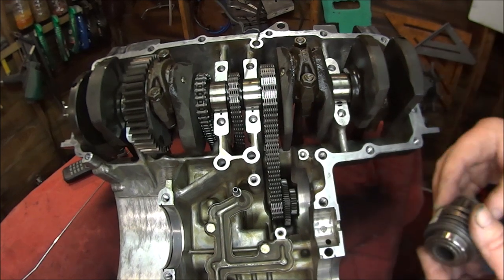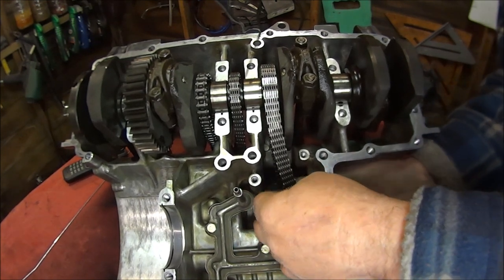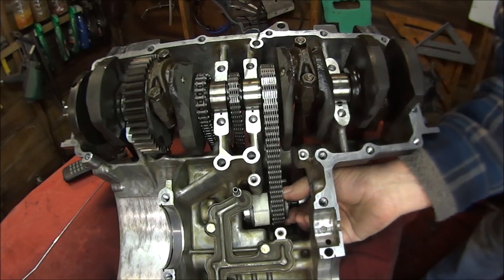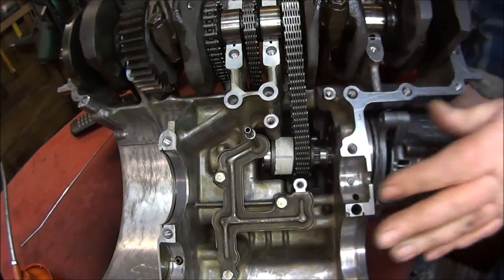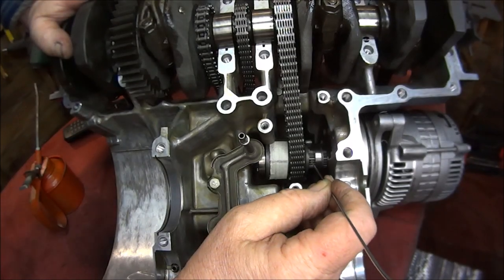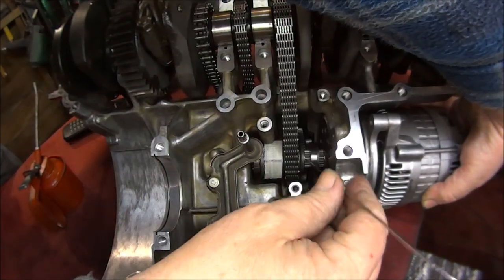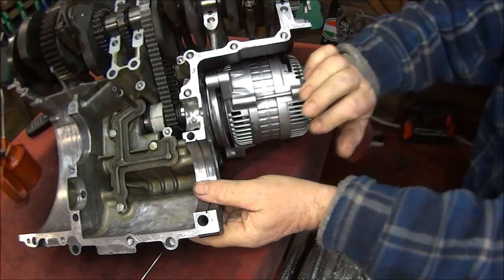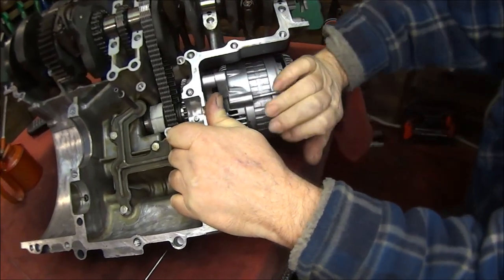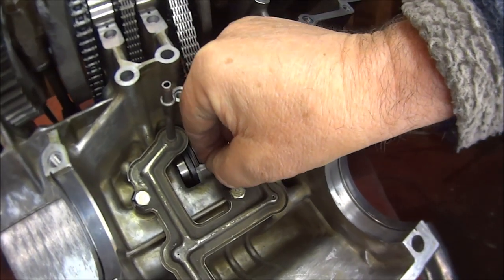Okay then, so we just slot this in — try and keep the alignment at the top so we can see the tape. Put it onto the chain — looks like a good position. Just put a piece of wire in the oil gallery, and then looking at the line-up mark — yes, I would say that's definitely lined up, so we can continue and hopefully give it a bash and it will go into place. There we go. Don't forget to remove your masking tape.